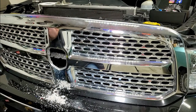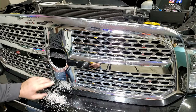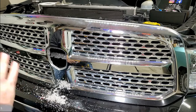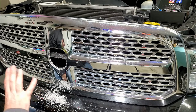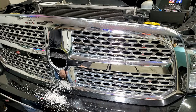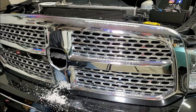The other thing to watch: when you're connecting those holes with the drill, rocking it back and forth for cutting effect, don't slip out and gouge a scratch into the grill. If you do, you're never going to be able to fix that — it's forever going to be there. You're going to know it's there and get pissed every time you see your truck with that beautiful lit emblem, knowing that scratch came from carelessness. So that's how we cut this opening. I'll get it cleaned up, get the emblem attached, and I'll show you how it looks once it's done. The wires will run over to the driver's side headlight on a US version.